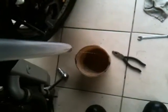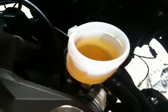See doing that? Let it spring back. It lets some bubbles out. Look at those bubbles coming out. See them? That's just draining away down in there, on the cylinder. As long as I see bubbles there, I'm going to keep doing this. Bubbles are my enemy. I don't like bubbles. I've got a big fast bike here. I want to be able to make sure I can stop it.